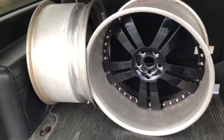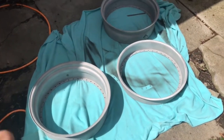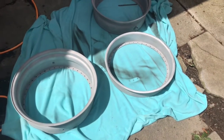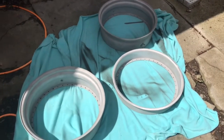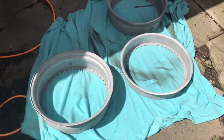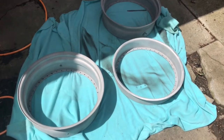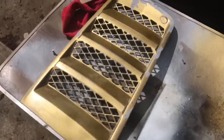These are the front rims — they're split apart and they've been sandblasted. I didn't sandblast the other lip, so that's over there with the centers right now. I'm using a Dupli-Color spray system for just the priming part, and then I'll spray the paint and clear with my gun. Getting ready to do the epoxy primer and then high build primer, then I'll seal it.